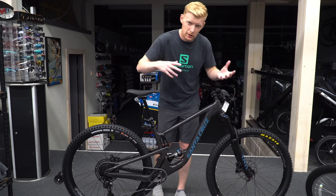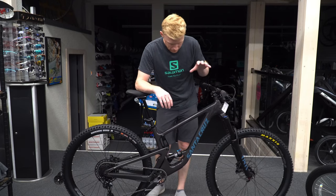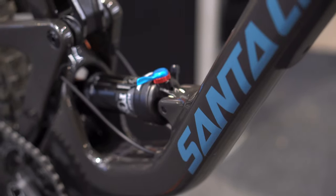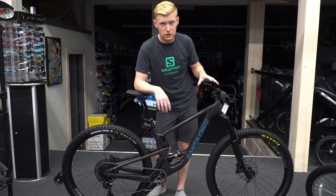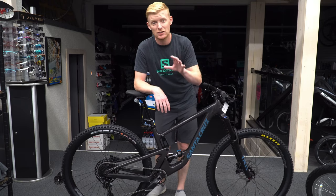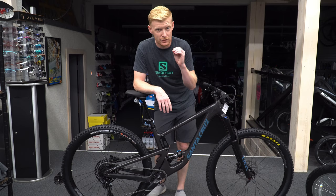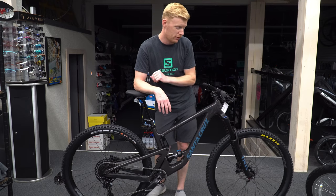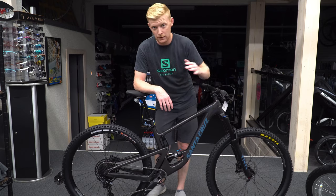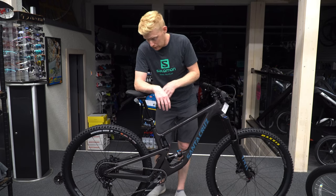Overall it's a super clean-looking bike. They haven't changed the frame this year — that was done a couple years back and there are no major redesigns. Maxxis Minions are on it again, seemingly the go-to tire for everyone right now. It still has VPP suspension with the ability to flip the chip, which makes a huge difference. You drop it a couple millimeters and change that head tube angle even slacker — on a bike like this it makes such a difference in riding style. Flip that chip at the top of a big mountain and it becomes so much more forgiving over hits and bumps, though on the climbs it does make it a little longer and wider-turning, less twitchy. You can switch it any time — just a five-minute job with an allen key.